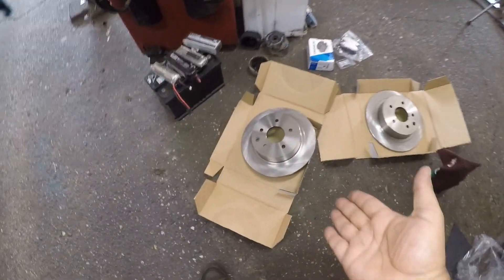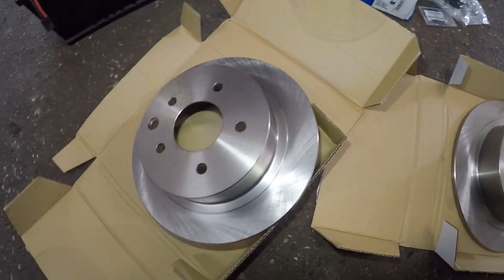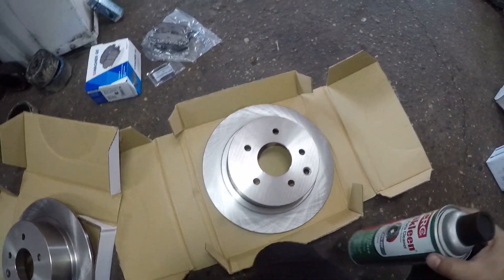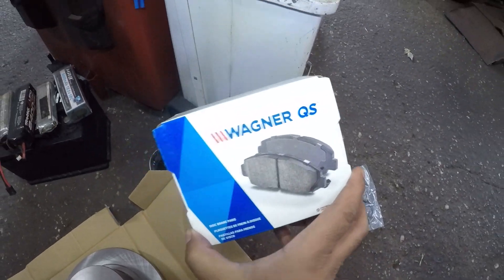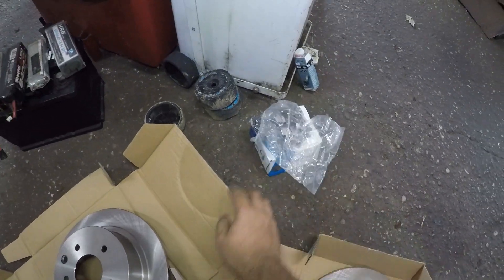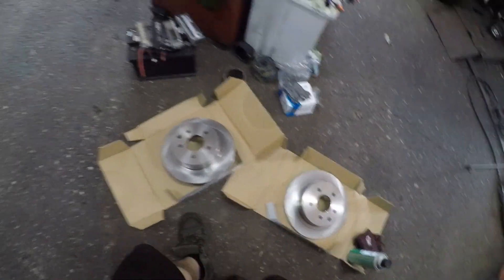For parts, my customer bought simple unpainted discs — I personally prefer electro-coated painted discs. We'll clean them with brake cleaner. We've also got Wagner brake pads, which come with grease, hardware kit, and the greasing packet. I'll use my own grease, but let's get this job cranking.